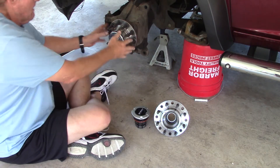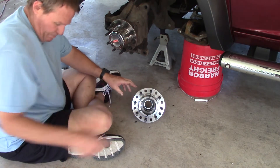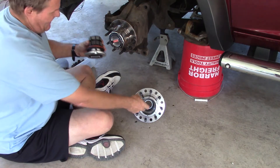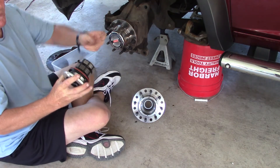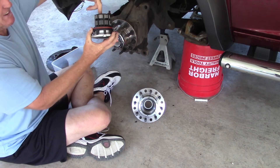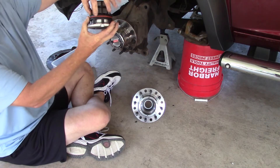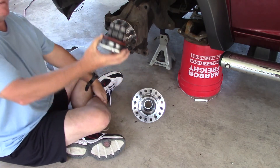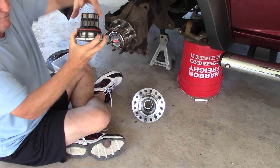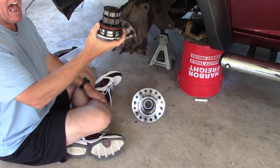For example, let's look at our hub. Our hub has got all those splines in there. This thing is sitting here — all these teeth are lined up with those splines. And inside here we've got a gear. At the very same time, this must line up with that one, which must line up with that one, which must slide together, and at the same time stay directly in that big groove with no give whatsoever. The probability of that happening all the time is very unlikely.